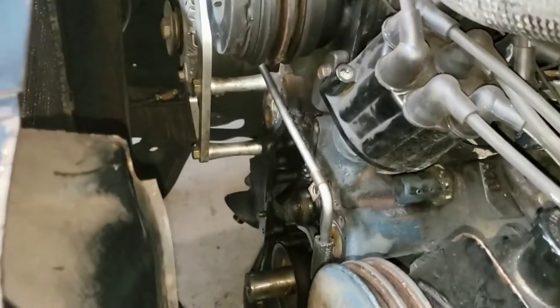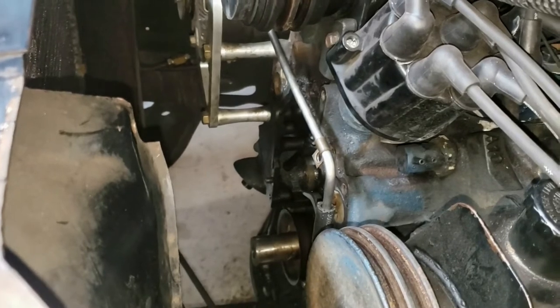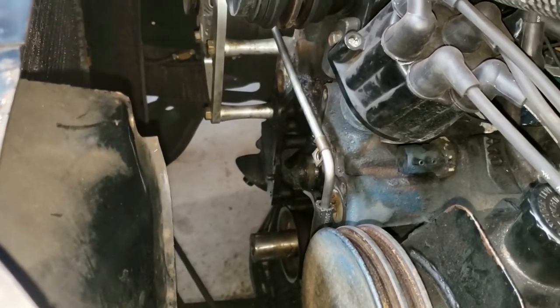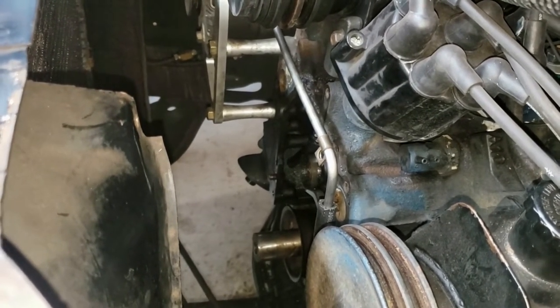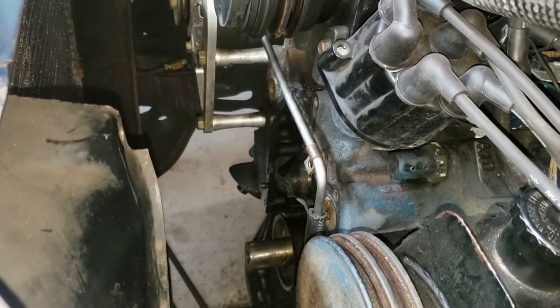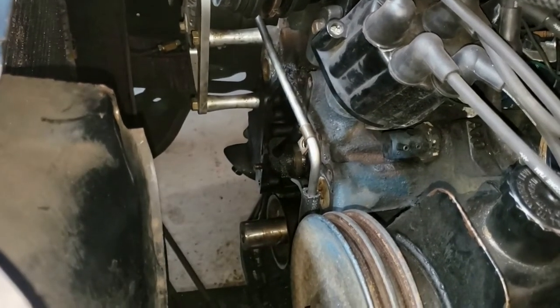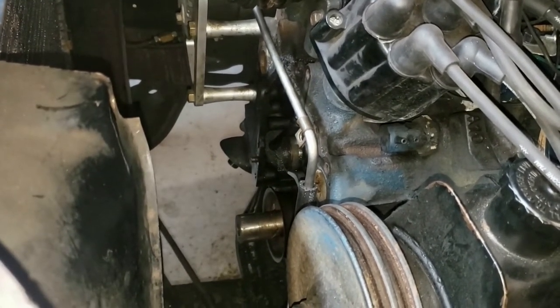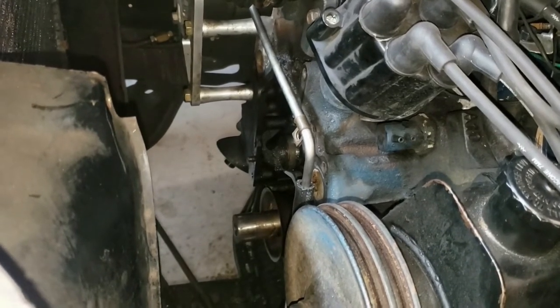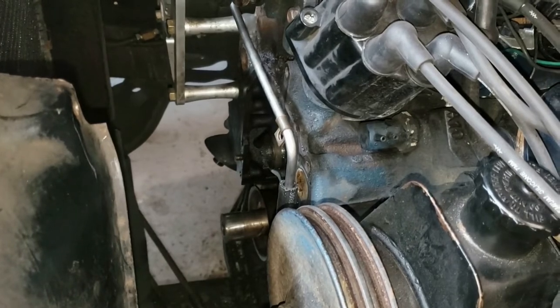All right, we got the old cover off there, but we're still at a standstill. I'll say that 10 times real fast. Still can't get the oil pan off. That's the next step, obviously. So what have I done to attempt to get the oil pan off? I have disconnected the oil pickup tube, and it is now laying down inside the oil pan, which is dangling under the car. It's 3 bolts, 2 on the motor, and 1 on one of the bearing caps.